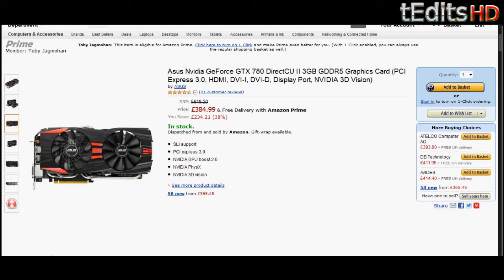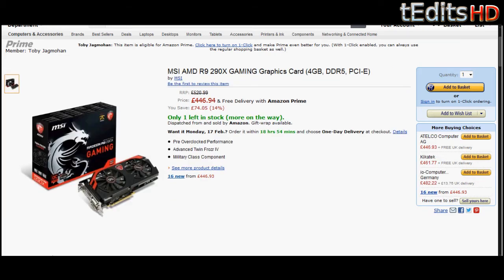An alternative to the GTX 780 is the AMD R9 290X, which will also give you exceptional performance. Both of these graphics cards support 4K. The main difference is that the R9 290X will support Mantle, whereas the Nvidia card will support G-Sync. Also, the R9 290X has 4GB of GDDR5 compared to the GTX 780's 3GB, though that doesn't make much difference unless you're playing very texture-heavy games. A word of warning: the R9 290X is fluctuating in price and is difficult to find. If you can find one, make sure you get one with a custom cooling unit, because the standard R9 290X gets incredibly hot.